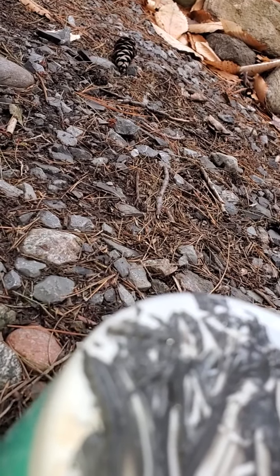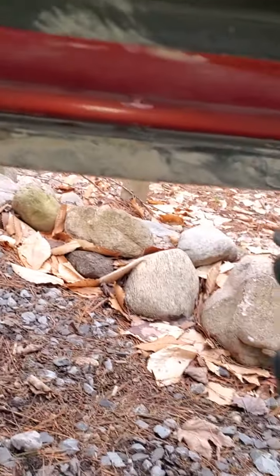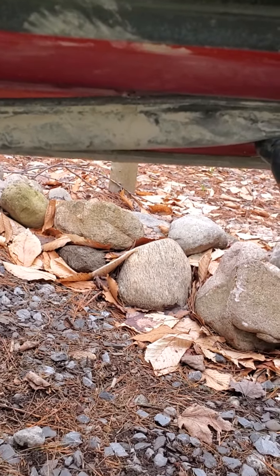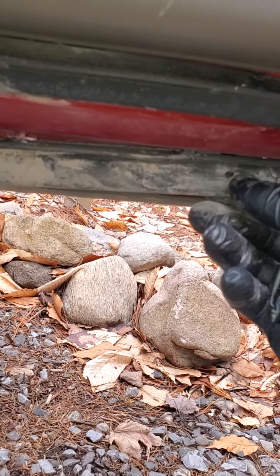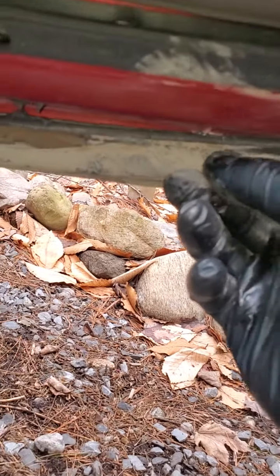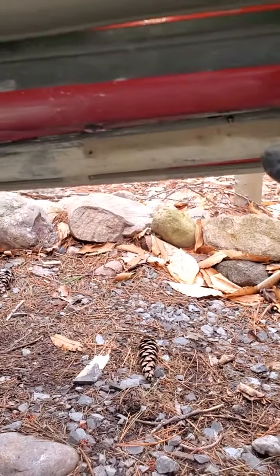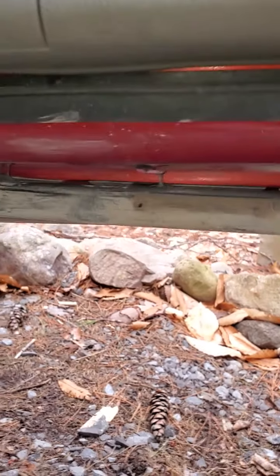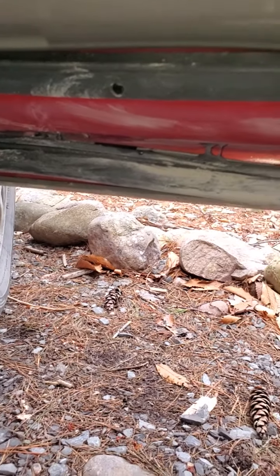This video's not going to be long. I'm going to finish right here so I can recycle this pin. All these holes are torn and ripped, so I can't use these pins anymore. So I'm putting epoxy in there, on both sides of them. See how that glue is starting to hold right now? Once that glue holds, the next step is I'm going to hold the epoxy into place and put the pins into place. That's why you want an epoxy with a slow working time — it gives it time to catalyze. That's how it gets to strength; that's why you mix the two products together.